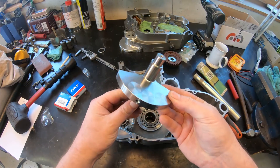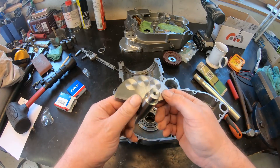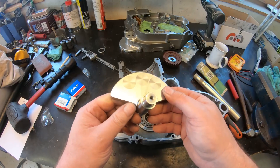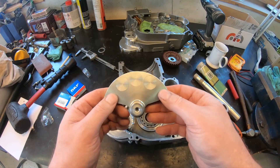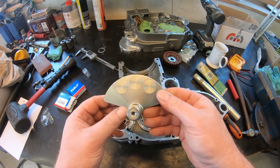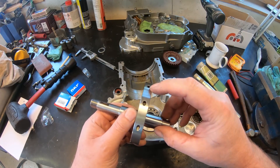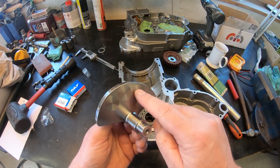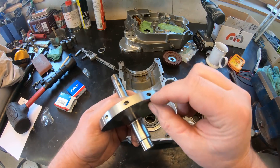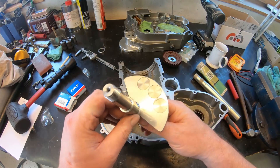Now we can fit the actual balance shaft, which has an ordinary design. However, I need a lot of imbalance on this one, so I had to put in tungsten inserts — an alloy of 10% copper. Normal steel has a density of 7.8, while this alloy has a density of around 16.2, making it more than twice the density of steel. These inserts are press fit and secured with a locking screw drilled with a small notch to ensure a very solid lock, plus Loctite — everything to prevent the insert from coming out, because if it did, it would be mayhem.